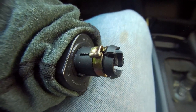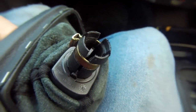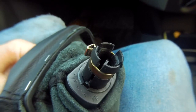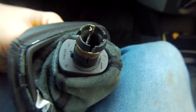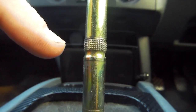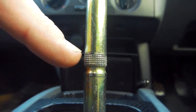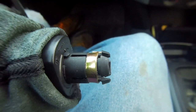If we look at the end of the gear knob, we can clearly see how the clip fits around four finger-like extensions that are designed to expand and contract to fit over the shaft. Internally, near the ends of these fingers, are four semicircular raised plastic bulge sections that then fit into a recess halfway down the shaft, just here. The clip then holds the ends tightly in place over the knurled section to stop the knob moving from side to side or twisting loose.